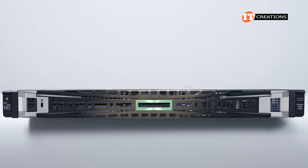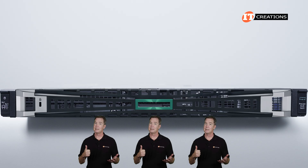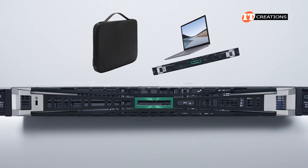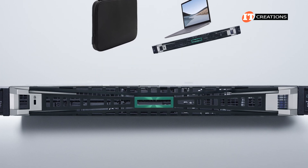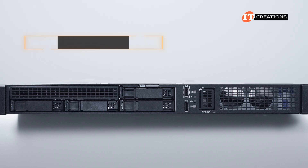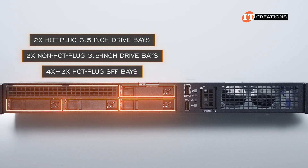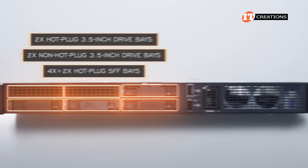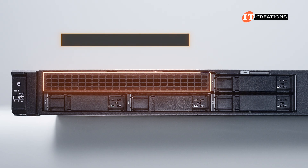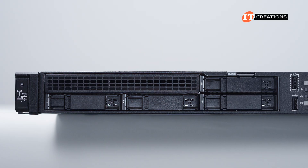The front of the system features HPE's first shooter game target bezel with green targeting frame in the center. It has a Kensington lock slot on the left. The system is so small you could basically carry it out like a laptop, so security features are welcome. After removing the front bezel, there are options for storage — either two hot plug or two non-hot plug 3.5 inch drive bays, or four plus two hot plug SFF bays. The plus two is for the media bay in the upper left, which can be outfitted with an optional 2SFF drive carrier, optional optical drive, or nothing but a perforated panel.